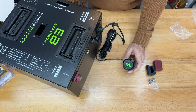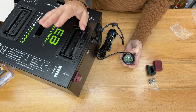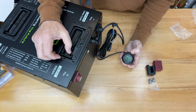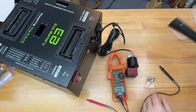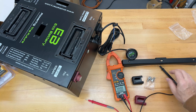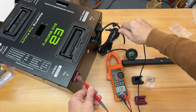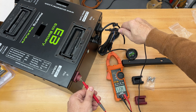Green backlight on the button, and there's our voltage. A 48 volt battery is what everybody calls them, but it's actually rated at 51.2 volts, and she's sitting at 97% charge — 53.2 volts. My meter says 53.34, but it's not a calibrated meter. There it says 53.2. Close enough for government work.